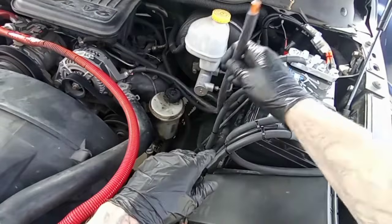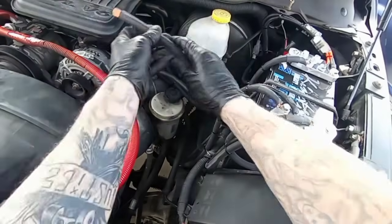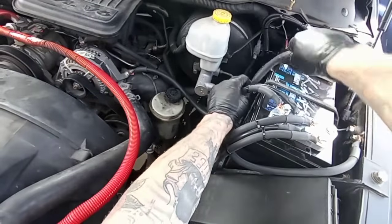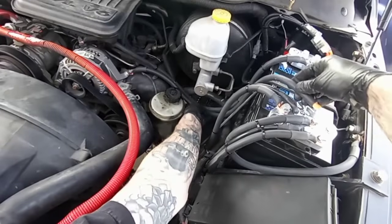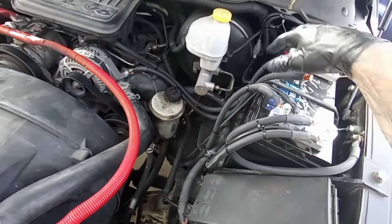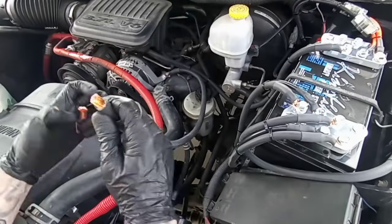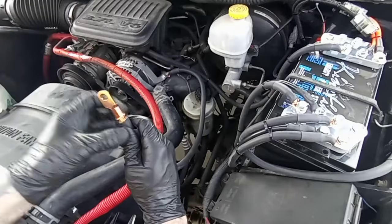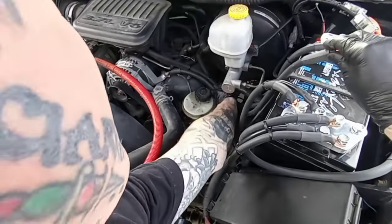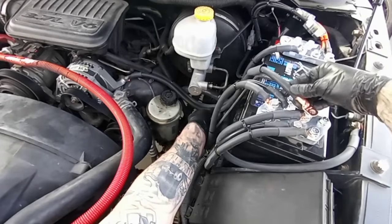And then when I do my first one, because I knew I was going this way, the wire will always have a natural bend because of the way it's rolled up. So I knew to put my lug that way. So right now, when I'm going to be bent, I'm going to have to work this wire. So always make sure your lug is on the right way so your wire doesn't look all messed up. See what I mean?